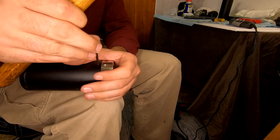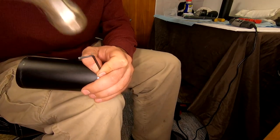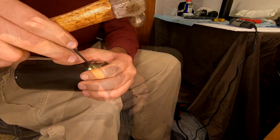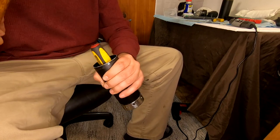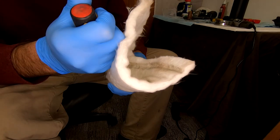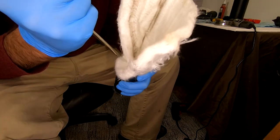I removed the end cap and rivets with a drill and Dremel, and then basically just riveted the new cap on to the cut-in-half silencer. It was a mess, and use gloves when you start getting into the core because you don't want this fiberglass packing material to get in your skin, and you definitely don't want to accidentally rub your eye.